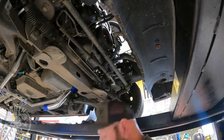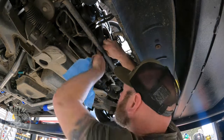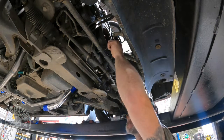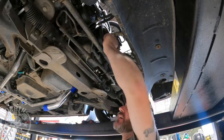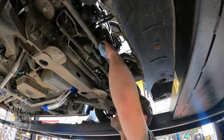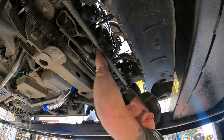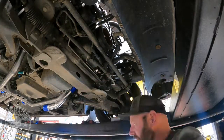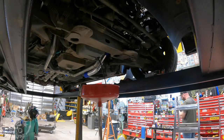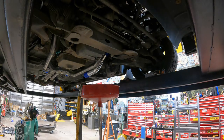You pack the tap full of grease so the chips stay in it, and then use a magnet to get anything else out. On a pipe tap it will usually go down about three-quarters of the way, but I stop at about half and check the fitting, because there's variance in fittings. Make sure it bottoms out right, then go from there. Now I'm flushing it out with a mix of WD-40 and oil — just trying to flush anything that went into that pan out the bottom.